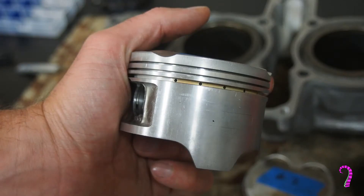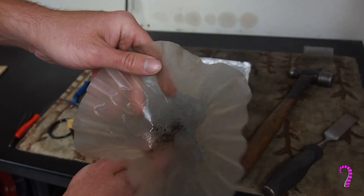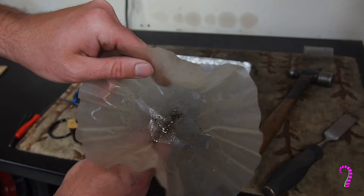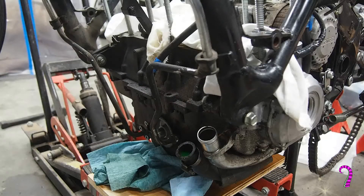Now with everything measured up and looking pretty good, we're ready to call it a day. We're going to put the cylinders away in a box until we get parts — in this case, rings. Based on the inside of the oil filter as well as the previous owner's work, we are going to be going into the crankcase on this one to check the bearing clearances and other things. So on the next episode we're going to be dropping the crankcase out of the bike — or rather, lifting the bike off the crankcase, which may not be pretty. We'll get into the real meat of the job, split the crankcase apart, though there's a whole bunch of things to remove before then and it looks like we'll be spending a fair amount of time in front of the parts cleaner. That's a problem for another day. Thanks for watching.